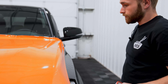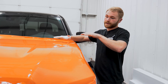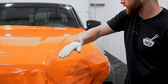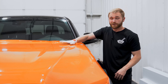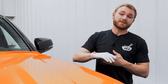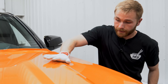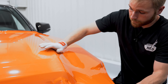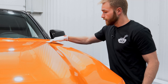Now I do have a recessed area — this is the biggest one on the hood. For that, we're going to utilize our pro glove and I'm going to start in the rear of this and push towards the front. I want to roll this body line real quick again so we do not crease the film as we go down. I'm going to take the palm of my hand and push it into the lowest point of the recess right off the get-go. I don't want to go in little increments because you can get adhesive lines as you stretch the film more and more. Because this hood is warm, we can do this without heat.